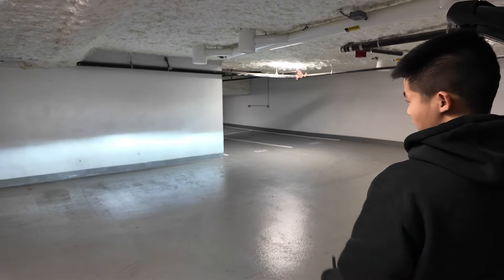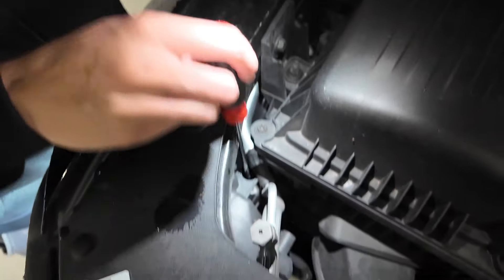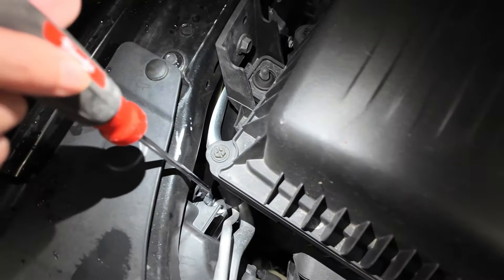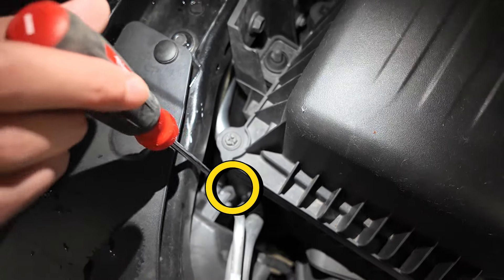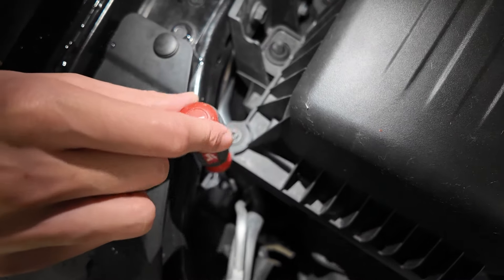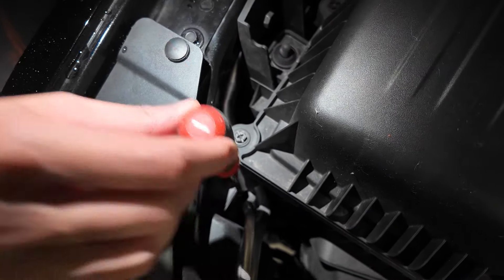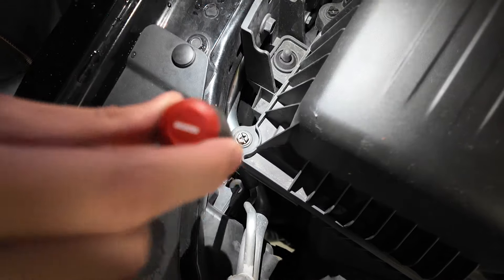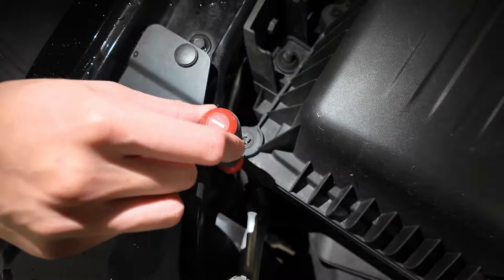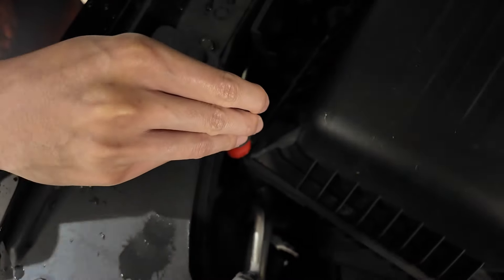Now we're going to go on the other side and make sure it's balanced. On the airbox side, if we're looking down here, that's where the adjustment is on the right of the vehicle. You just want to put a screwdriver in there — I prefer a flat head because it locks into place properly and it's quite long so it can reach. Make sure you're not using a drill or an impact; you might damage the adjustment system. So now we're going to turn it clockwise, and this should raise the headlight.